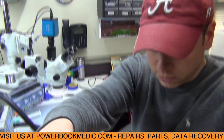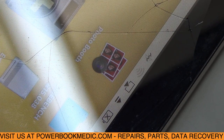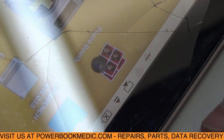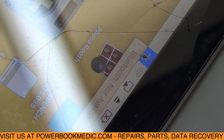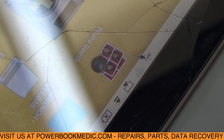I've got it booted up right here on my desk. Let me zoom in where it says no Wi-Fi. That symbol right there is your Bluetooth — it's not supposed to have that squiggly line through it. When it has that, if you click on it, it says Bluetooth not available. Sometimes in the Wi-Fi area it will say Wi-Fi hardware not found. But the Bluetooth, even after replacing the wireless card and the flex cable, is still getting no Bluetooth.